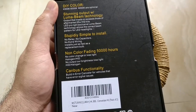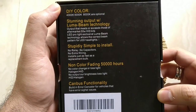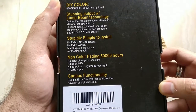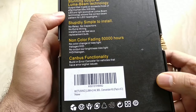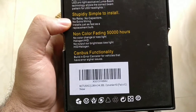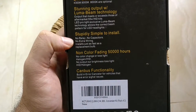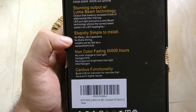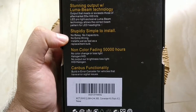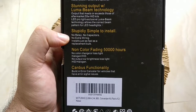Let's go through some of the specs of this bulb. 6000K is the color temperature, so it's crystal clear white. They're guaranteed for two years by the company. It's non-failing for 50,000 hours. It's got a built-in fan to keep the bulb cool and long-lasting. There's no capacitor or relay work needed — it just replaces your existing bulb as a normal one. It also has an error corrector.